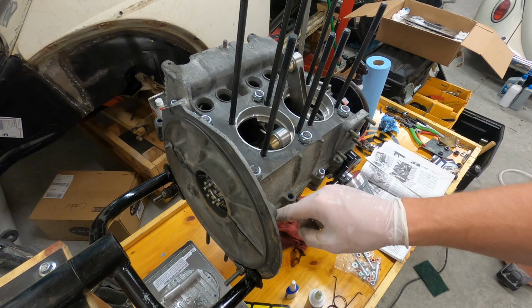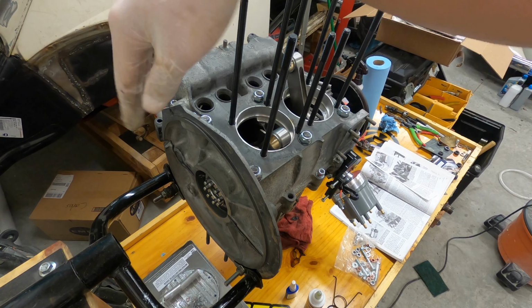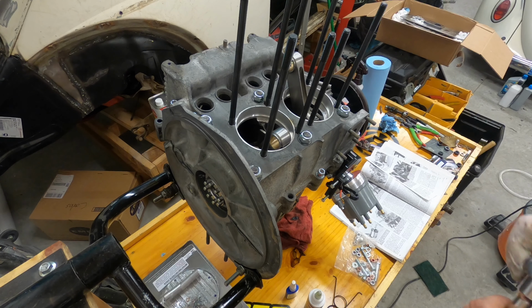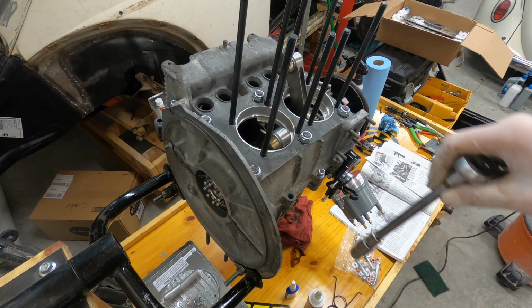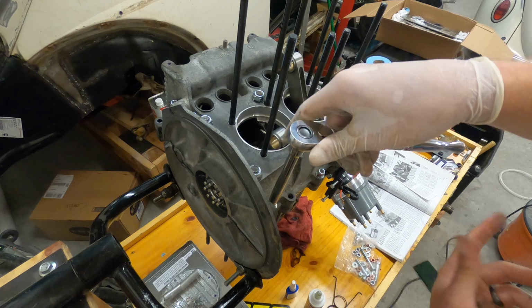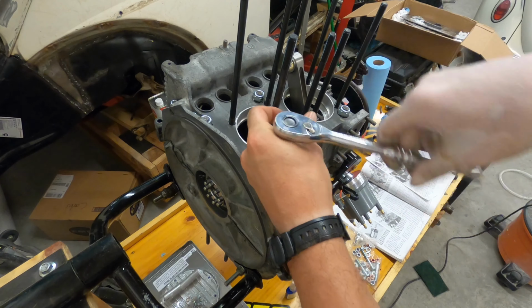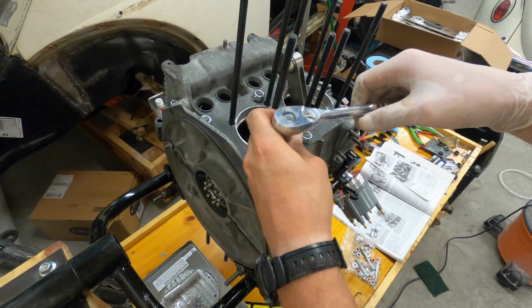All right, then we're gonna finish up putting the washers and hardware nuts on all the rest of it, the bottom side of this hump. Then you got a couple of bolts and nuts as well. We're going to snug the sucker up, and then we're going to torque those down. The manual says 14 foot-pounds, but I've heard 16, 17 from other people.